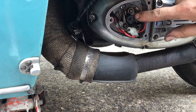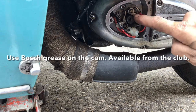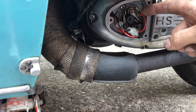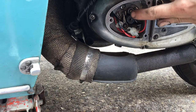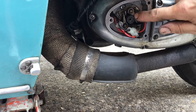Another thing to remember — from the club they do this cam, and these wear out. After a while you can get quite poor running. There's a little tiny nylon heel that rubs against this cam, and as it rotates it causes the points to open and close. It's important to keep this well lubricated with the right grease. Electronic ignition systems are available if this is really worn.